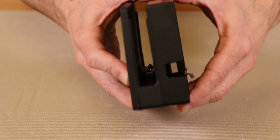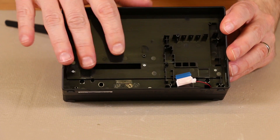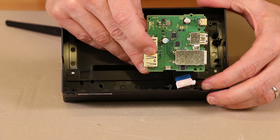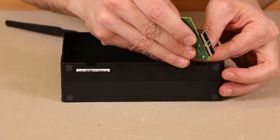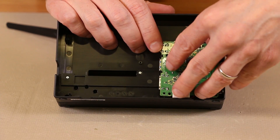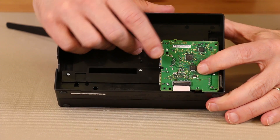There we have it — it's now together. We'll install the screws that hold it all together on this side. Now that those nine screws are installed and everything is nice and tight, we're going to install the motherboard back onto the dock. As you remember, this connector goes on the bottom side, then we flip it over and the ribbon cable goes on this connector. Now that the ribbon cable is installed and snapped down into its lock, we angle this motherboard to get it to go all the way in, and then it's fully installed.